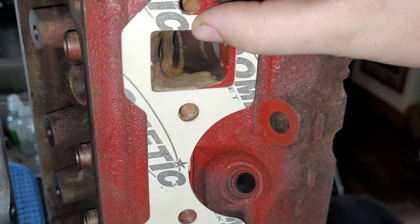Here are the E7s that we ported, and here are the AFRs — just to give you a little comparison of the two. These are the intake ports. Really the only thing I did to the intake was I just kind of touched the pushrod bulge — I didn't even remove the whole thing. As you can see, way more open, way more line of sight on the AFR. You can actually see down into the chamber, whereas the E7 you can see a little bit, but not quite as much.